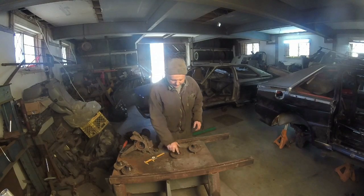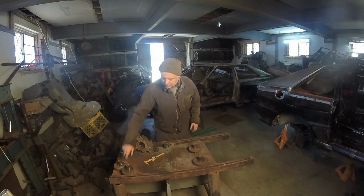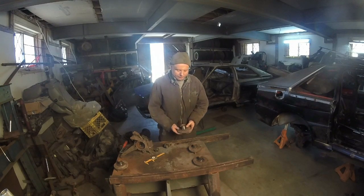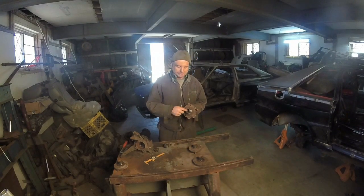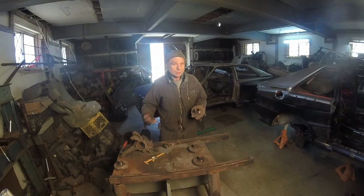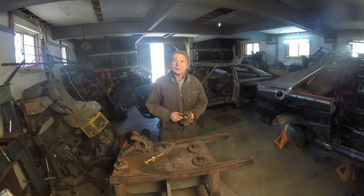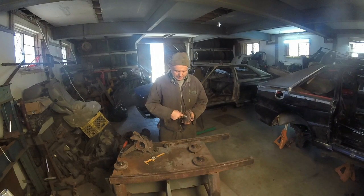What we're going to try now. I only have a couple of these, and I also have to do the ones on the A2s. This is the rear hub from the 91 turbo 20 valve. It was a wagon too. It's virtually identical to that hub. The difference is the spline cut. I'm not going to count the splines, but it's like the difference between a fine thread and a coarse thread. Those things are coarse splines. This is like a fine thread, almost like an A4. An A4 has very fine threads on the internal portions of the hub.